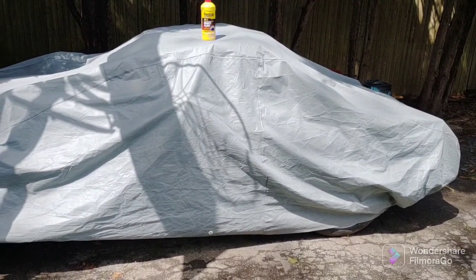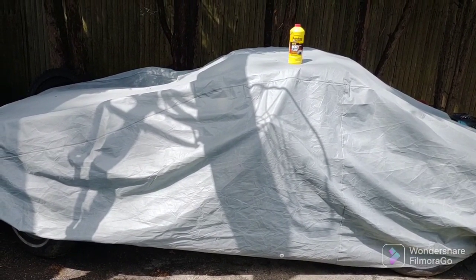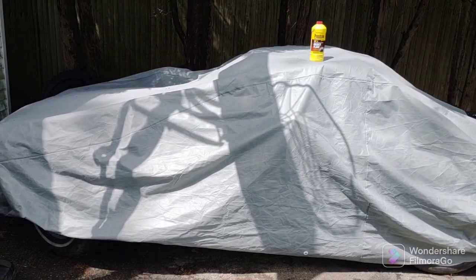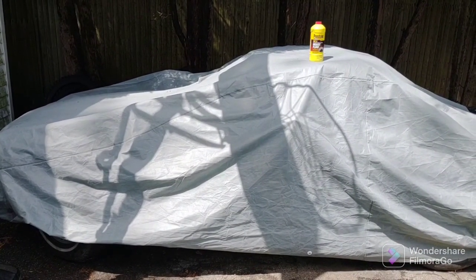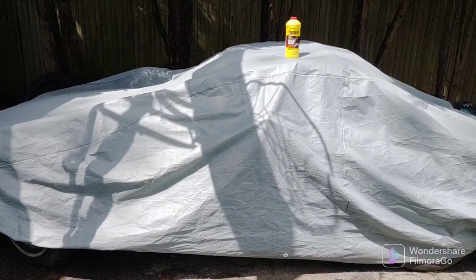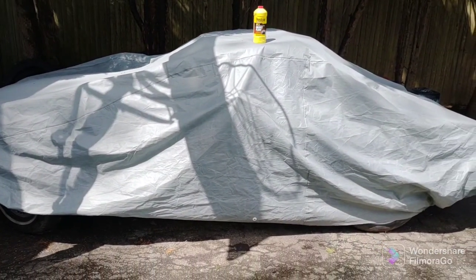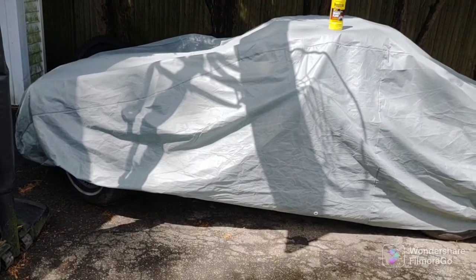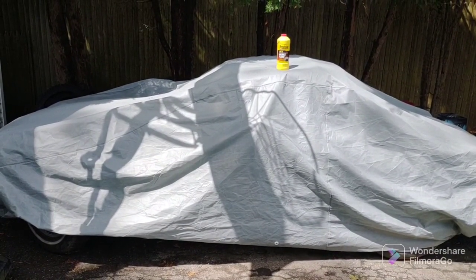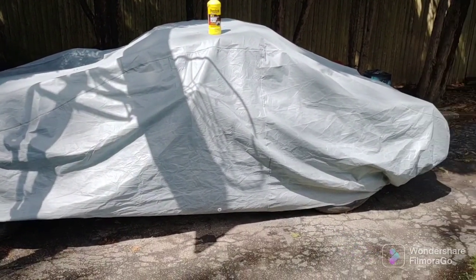Gravity bleed, you simply start from the furthest and you put a rubber tube on your bleeder. You loosen the bleeder half a turn, 3/4 of a turn, and you just wait and let gravity bleed it out until there's no bubbles. You look at your clear hose, and when there's no bubbles, that circuit is now free of air. And you always check your master, always replenish your master with brake fluid. Never let it get too low where air is going to get into the system.